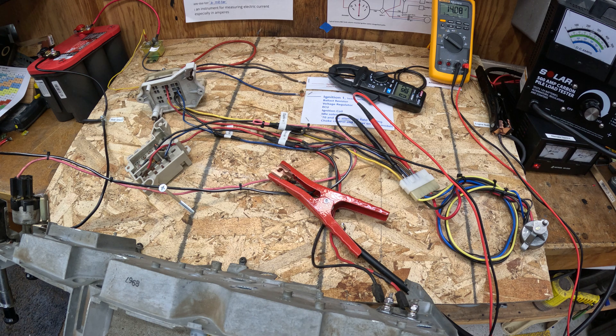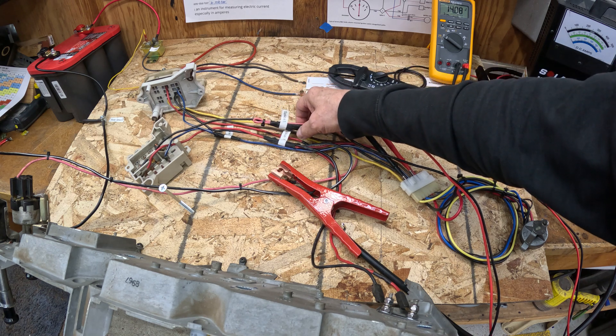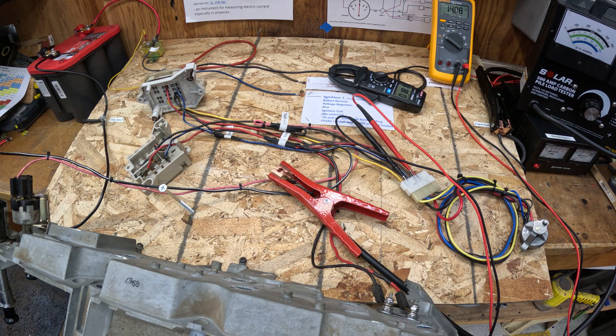Those particular terminals, just like the Packards in the bulkhead connector, don't really accommodate the real-world current that passes through them. While we have the fixture going here for the other discussions, I'm going to do a little demonstration of the voltage drop we get through those sometimes. I'm going to load this on the accessory splice — B-body calls it splice 5, E-bodies I think it's splice 3, but it's the same one.